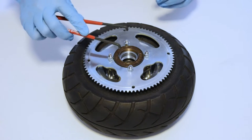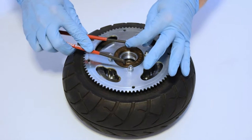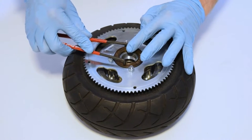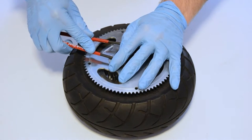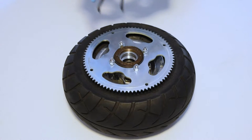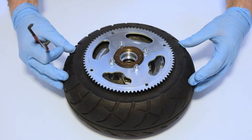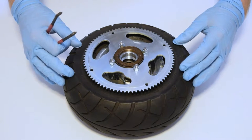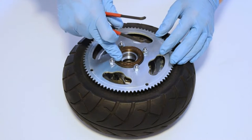Take the two pins and locate them on top of the two divots on the freewheel, and you want to rotate clockwise to remove that cover. We recommend doing that with the wheel on a hard flat surface, and with the freewheel already installed.